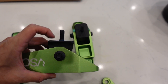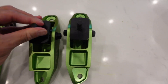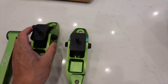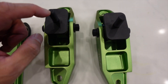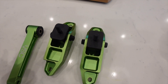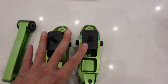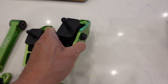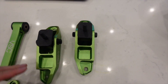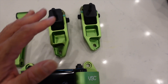The VSC engine mounts do have the studs already in there. It doesn't seem like they are removable like the Perrin ones. I believe there's a stainless steel liner inside the aluminum to keep the threaded bolt in there and keep it from shearing out the aluminum like it did in the Perrin mounts. I'm hoping I will not have the same issues. Something that's going to be difficult is installing them with the studs — that's the one thing I liked about the Perrin mounts. I will compare these two when I take out the Perrin mounts, and then I will have these installed.